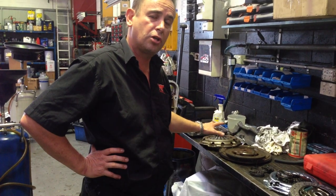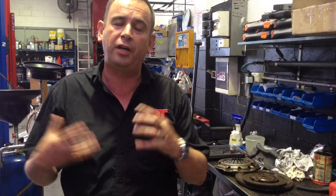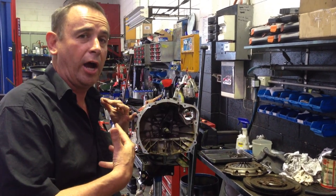This particular model has got a push type clutch, the driven plate and the flywheel. What's actually happened is the previous owner of this car — prior to this owner buying it less than a month ago — didn't maintain the clutch properly. We suspect that the previous workshop installed the clutch incorrectly and didn't grease the slide mechanism on the release bearing assembly, and effectively the release bearing has seized, locked onto the driven plate and the cover plate of the clutch, then torn itself around the end of the gearbox, which has now resulted in damage to the gearbox as well.